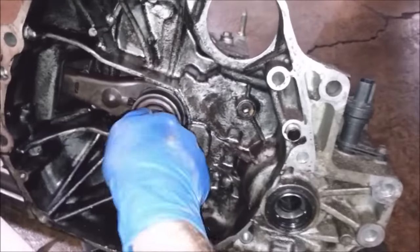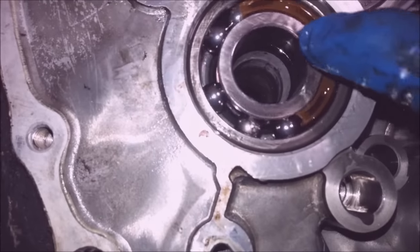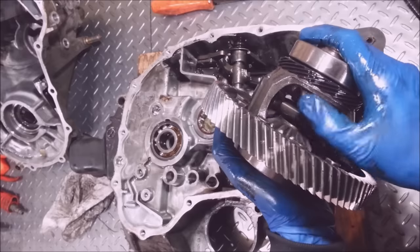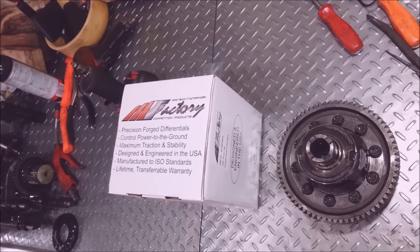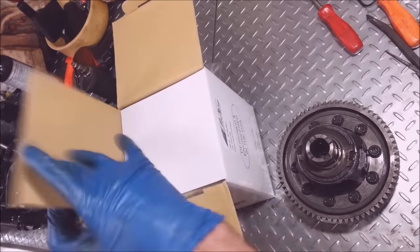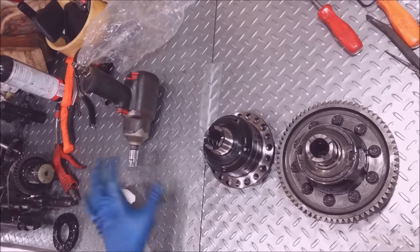Pushing the clutch: no noise. Let out: noise. That's an input shaft bearing in my transmission — I'm going to rebuild this thing. That one looks like hell — that's my noise. This is a one-wheel-wonder; junk. And of course, what would this job be without an M Factory LSD? I splurged. I'm going to need it someday — I'll get two wheels to spin instead of one.